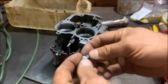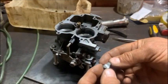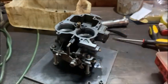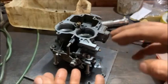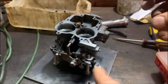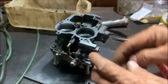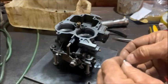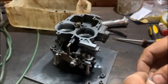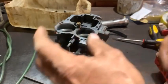These spray pump jets come in different sizes. I took that one out and it's a 50 — I don't know if you can see the 50 on it. That spare one I had is also a 50. These are from the 36 D67 — that's a 70 and that's also a 70. So they come in 40, 45, 50, 55, 60, 65, 70, and I think a 75. If your spray pump works properly and you still have a bit of a flat spot when you pull away, just put in a bigger size — go from a 50 to a 55 or 60 until your flat spot goes away.